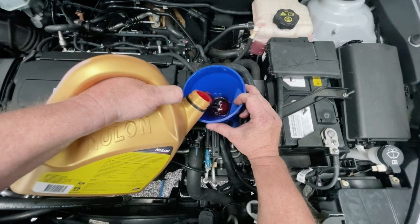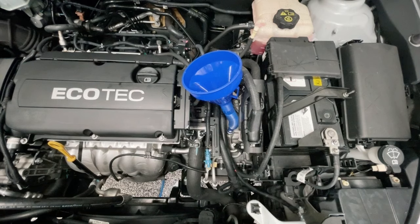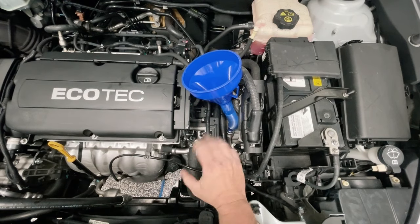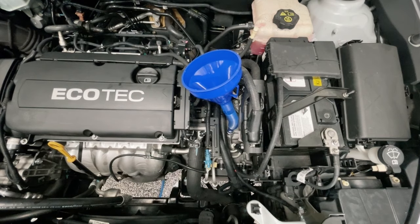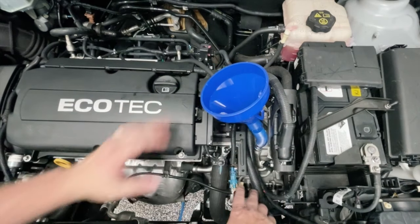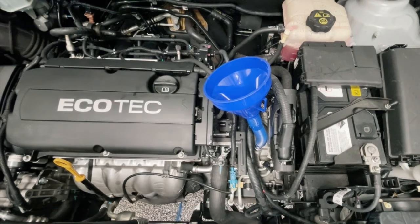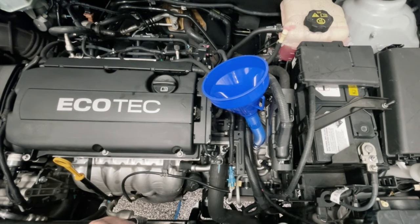Now I also want to say that the car has just been driven around for the last 15-20 minutes, so it certainly is at operating temperature. This does need to be checked at temperature, so we're going to start the car up and just let it idle for a few minutes before we even begin our next step. I'm just going to leave that funnel in there while the engine's running — that's going to be no issue. I'm just going to let that run for a few minutes and we'll duck underneath the car.